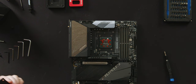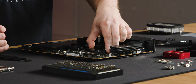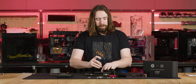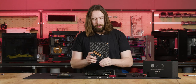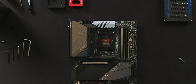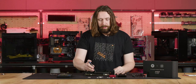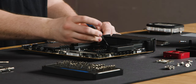With the loading mechanism away, install the CPU — the diamond marking goes to the top left corner where the little square protrusion is on the socket. The die guard also has a cutaway for that little square so it can only fit in the correct way. To reinstall the die guard, use the supplied button head UNC screws and put them in very loosely at first so you don't pull the die guard out of flat — put all four in loosely and then very slightly tighten them. These are not applying pressure for the block — tightening them will not improve thermal contact — it's just there to protect the PCB and make electrical contact with all the pins. If you have the 0.6 Nm torque screwdriver, that's perfect.